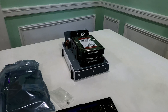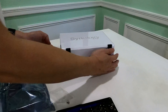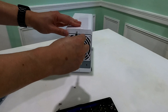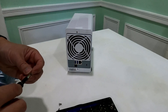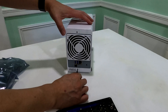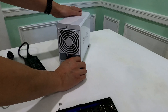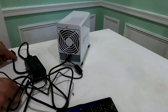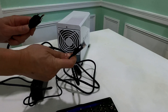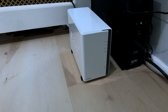Once all of the eight screws are in position, go ahead and slide the cover back on. To secure the back cover, all you need is two screws — one on the top and one on the bottom. And that's it. I don't know why there are extra screws, but it is what it is. Now let's power this thing on. Go ahead and plug the power brick in and the ethernet cable that's also provided. Plug the ethernet cable into your network and plug the power cord into your outlet. Everything is now plugged in. On the front, there's a power button — go ahead and press it and power it on. With the blue light blinking, you know it's good.